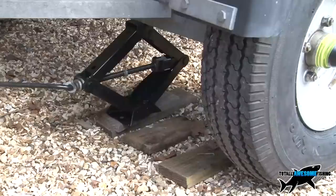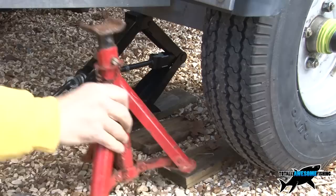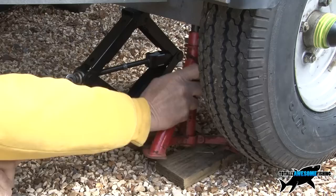There are a few tips I'm going to show you before you even start getting to this stage. Now, if you've got your boat jacked up — which I do if I leave it for long periods of time — I don't leave them standing on the actual tyres. I jack them up and put them on axle stands, which are dead cheap to buy. Get yourself a pair of axle stands, put them on, bump them up, drop them underneath and lower the trailer on top of it. It just takes that strain off the wheels.